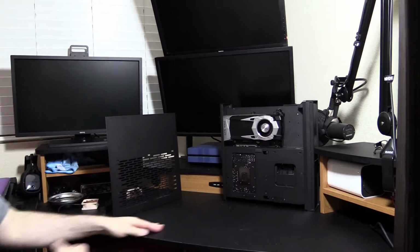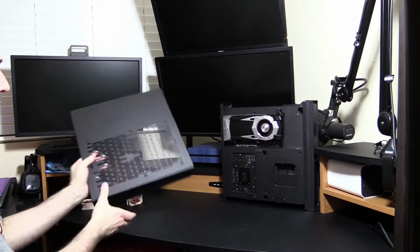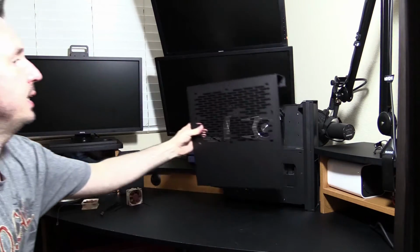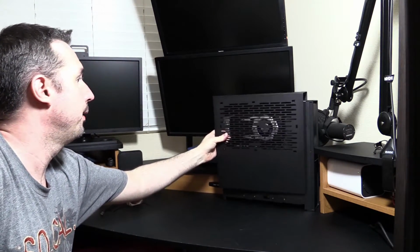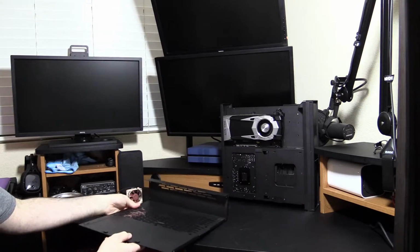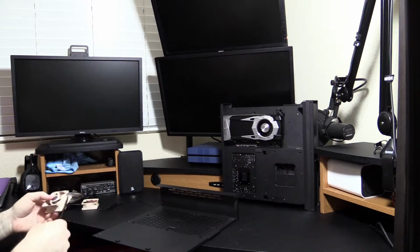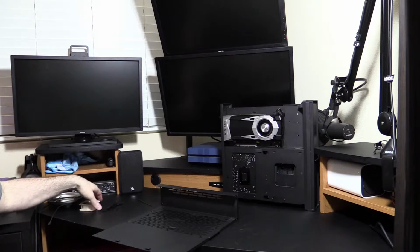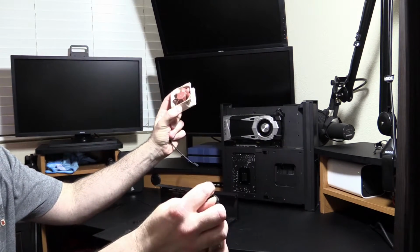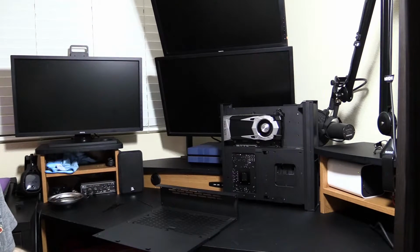All right, so what we're going to do is zip tie the sucker. Again, it goes like this. So over here, which is over here now. And I'm going to use a Y adapter. There's only one free spot on the motherboard, so I'm going to use a Y adapter so they can share the free spot. And I'm going to use an extension, and it should reach.